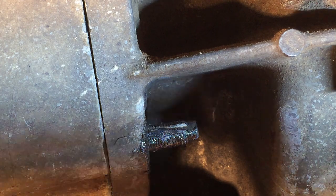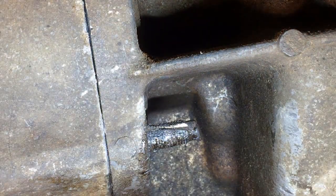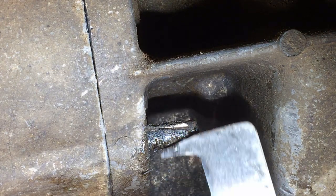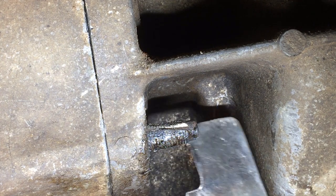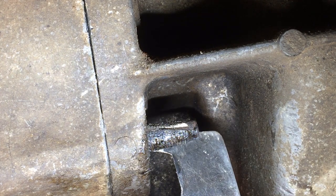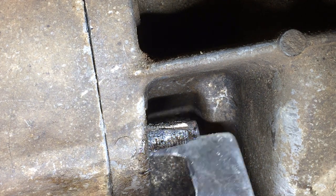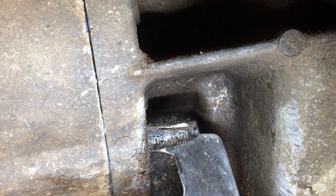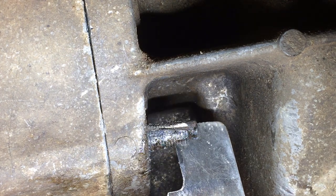I just can't get that sucker loose. The corrosion has built up so much inside of this hole against the stud — it's like a wedge. All I could do is push that rust dissolver gel into there, let it sit overnight, and then pick at it with this tool I made. It's really not going deep, so I'm not getting much of it.